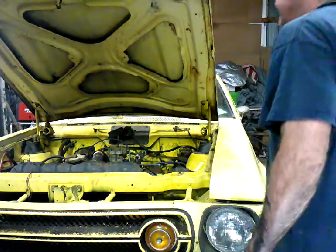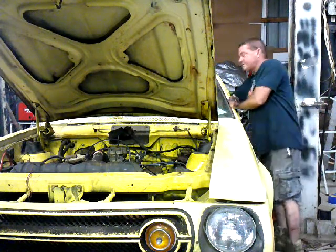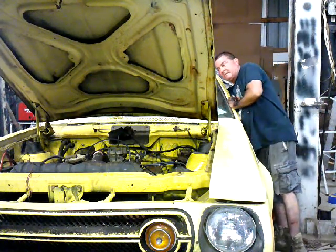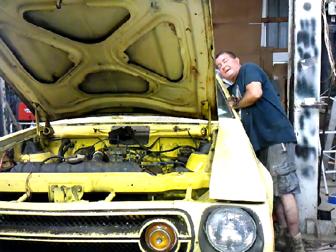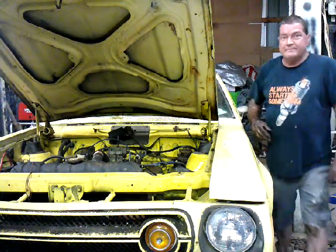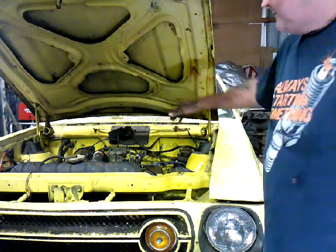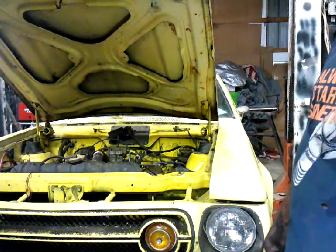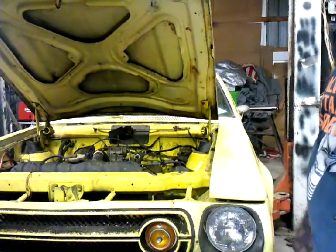All right, people. Keep your fingers crossed. These pumps are usually noisy once they start picking up gas. Here it is. Can you hear that? Oh. Well, there's gas, because you can see it coming out the pipage there. So that means I got a little too much fuel pressure. So I'm going to adjust that really quick. I'll show you all how to do that.